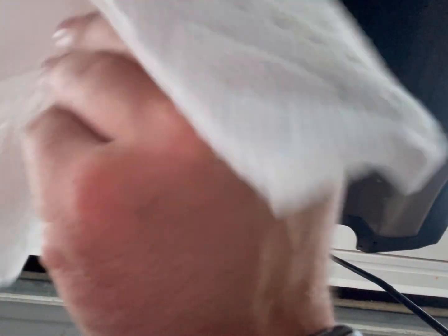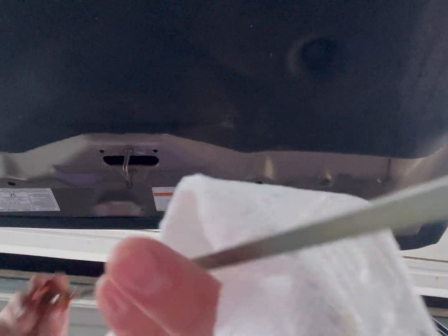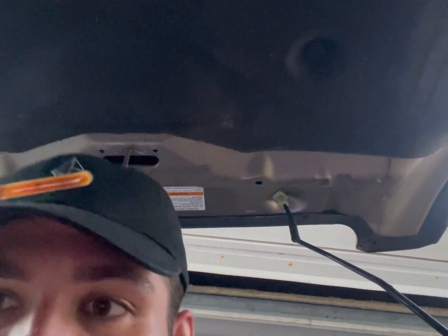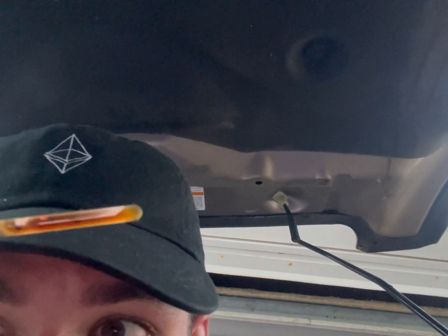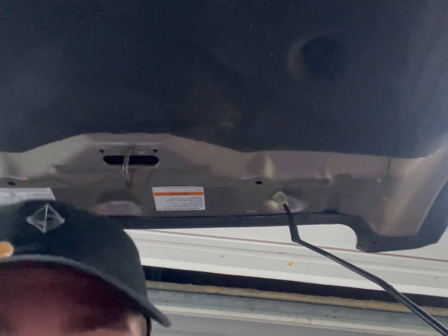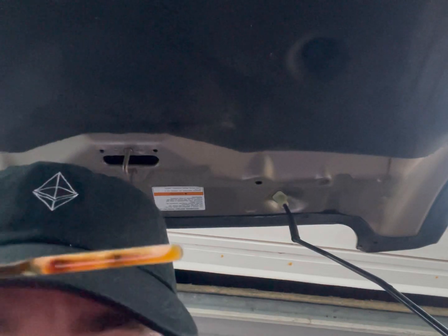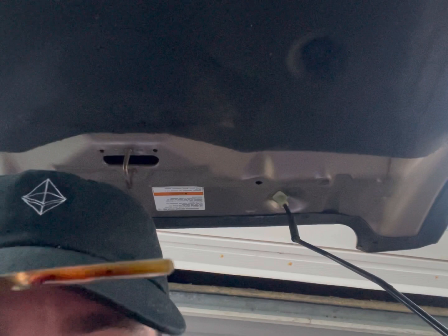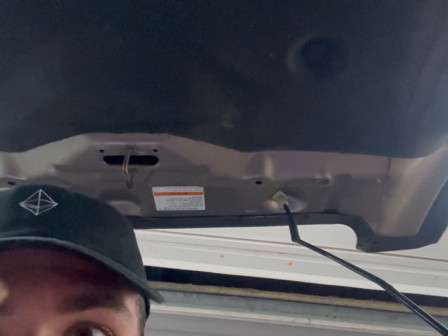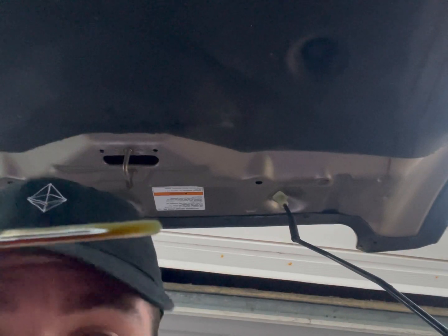If the oil is still in good quality, you can wipe it off and get back in there. Always check your oil here and there, especially if your car leaks or burns it off. While you're doing this, check your little dots — every dipstick has two little dots and the oil is supposed to be between those two dots. I'm looking like I'm running a little high, if not perfect. On the second dip you can see it is a little bit darker on the amber side, because it does have 3,100 miles. I like to change my oil every 4,000 miles, so this is definitely good oil quality.